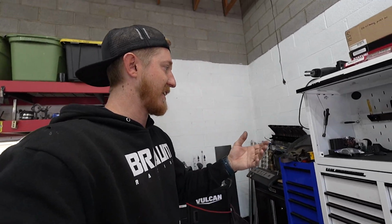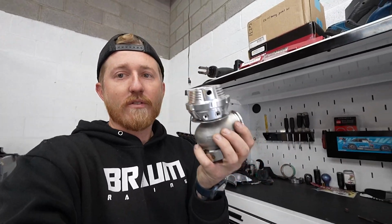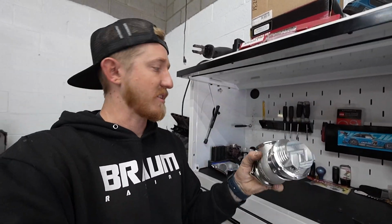So at least for this video, I'm going to try and get the downpipe made, maybe the exhaust, but for sure the downpipe made. I'm going to try and do the dump pipe. And then I need to move my coolant reservoir, because where the reservoir is now, I can't bolt on my wastegate because it's just in the way. It is partially manifold design, partially because my wastegate's a little big. I'm using a Pulsar 45 millimeter, so wastegates just aren't small, and even if it did fit, it's super duper close, and obviously we don't want to be melting these stupid BMW classic plastic reservoirs.